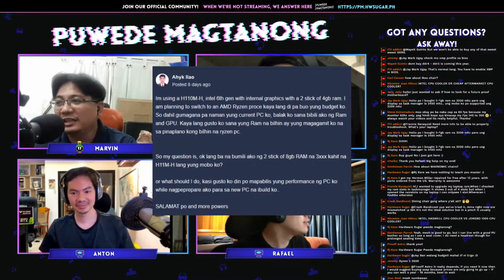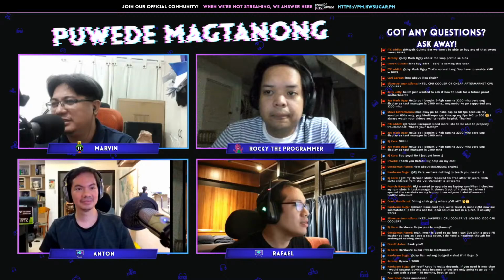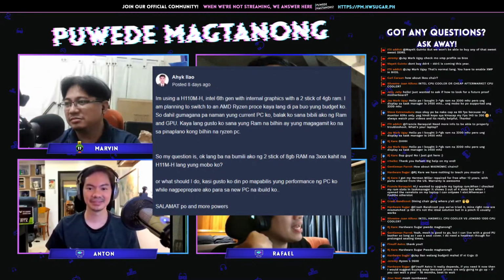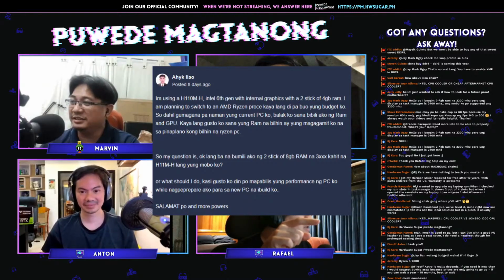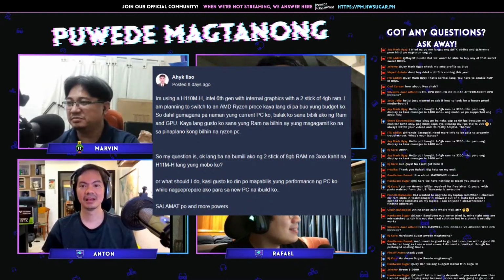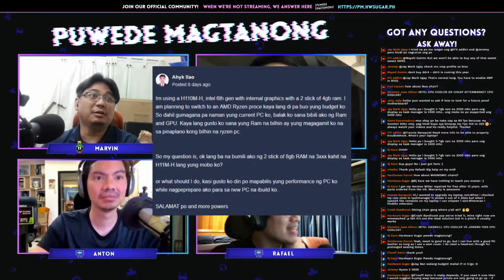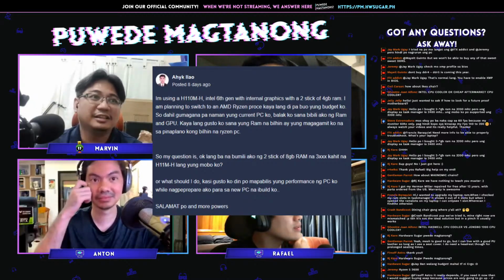But I forgot na kung what happens if you put a higher speed RAM in a lower speed slot. It just clocks down, diba? It clocks down. It just goes up to the maximum na kaya ng mobo. Yeah, but at the same time, he's planning to buy a future PC. So he's thinking that he can reuse the part. But is this DDR3 RAM or DDR4? It also matters, kasi 3,000 megahertz, so DDR4.